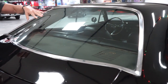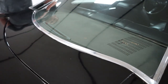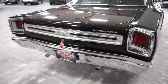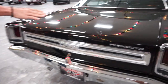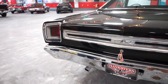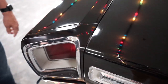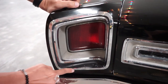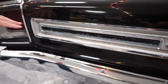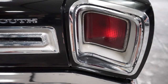You do have your hat rack with your speaker grills. You can see the passenger side speaker grill is collapsed in a little bit on the back, but overall in real nice condition for being probably original from 1969. Big quarters mean a big deck lid. The deck lid fits nicely, flush to the rear quarters, and your gaps are pretty uniform for such a big deck lid. You do have some brush touching going on over here. For those familiar with Mopar products — the Road Runners and the GTXs — the chrome does patina around the rear tail lights and rear valance. This one has what is probably original patina from 1969 around the rear brake lights and deck lid.